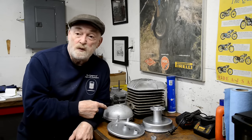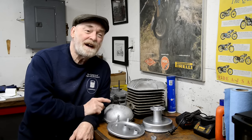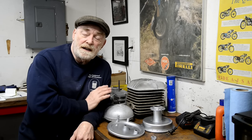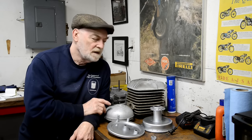Anyway, as I say, that's it for this week. We'll do that repair next week. I don't know what else I can do till I get this stuff for the engine. Should I just buy the bearings? If I buy the bearings and the seals, which I can get from McMaster-Carr overnight, I could completely build the bottom half of the engine. We have to tap a couple of holes to put the electronic ignition on, so you'll see. If I order them over the weekend, they'll be here Tuesday. We can build the bottom of the engine. We'll at least find some stuff to do next week, because the only other thing is getting the frame sandblasted and painted, which I don't really show you anyway, and that's only a day's job.